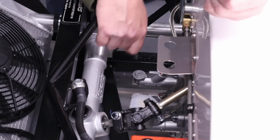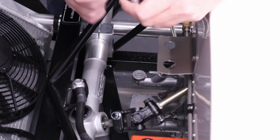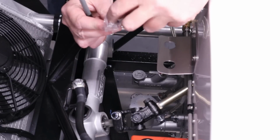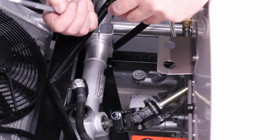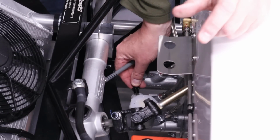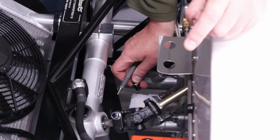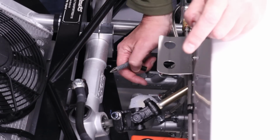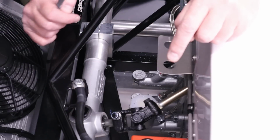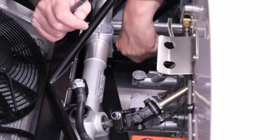So we have two master cylinders down here, and what we have to do is remove the plastic bung from each. And then, as I showed you earlier, we have these beautiful billet alloy barbed ends, with a washer that I've just dropped, which screw into these. And the copper washer, make sure that's a fluid tight seal. And then what we can do is cut the lengths of tube to the reservoir and then tighten up the Jubilee clips, all the worm drives, whatever you want to call them. And that's it, easy stuff.